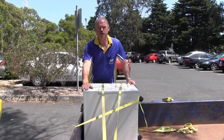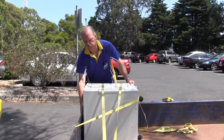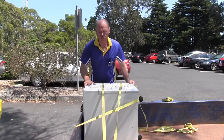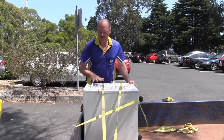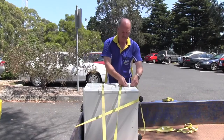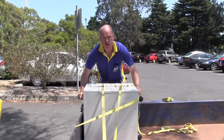When you're carrying items like this chest of drawers in your trailer, make sure it's hard up against the sides and the front of the trailer and use your straps to pull it down and into the corner. Check that nothing can actually come out — like this drawer, you might need another strap threaded through to hold it in place.